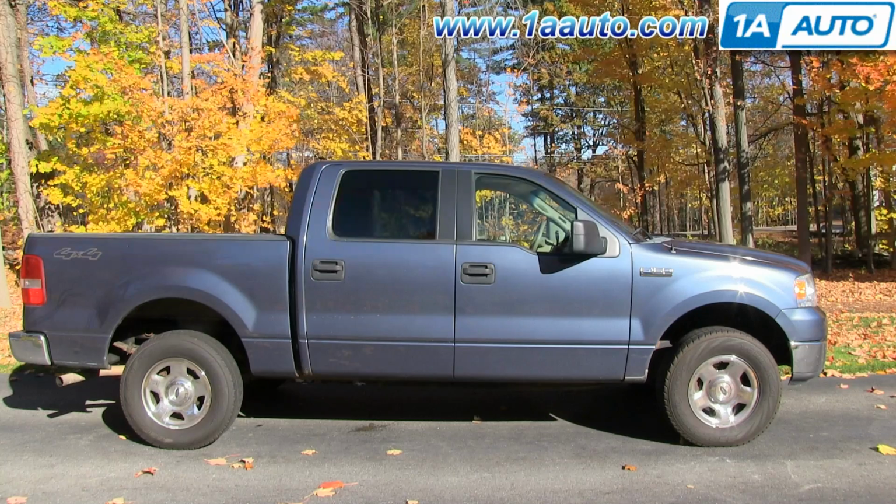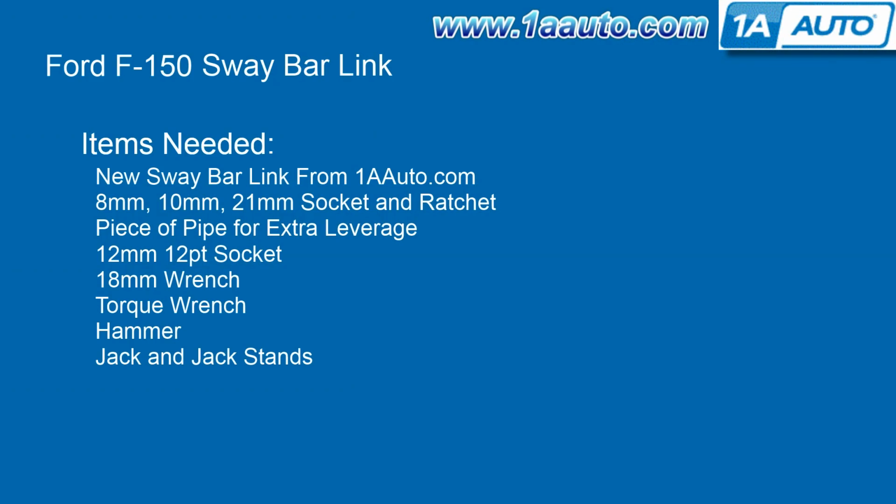Thanks. In this video, we're going to show you how to replace a sway bar link on this 2005 Ford F-150 with four-wheel drive. And we show you on the driver's side, but the passenger side is the same procedure. The items you'll need for this are a new sway bar link from 1AAuto.com, an 8, 10, and 21mm socket and ratchet, and a piece of pipe for some extra leverage, a 12mm 12-point socket, an 18mm wrench, a torque wrench, a hammer, and jack stands.